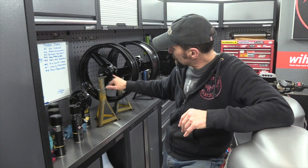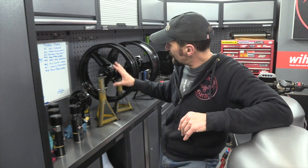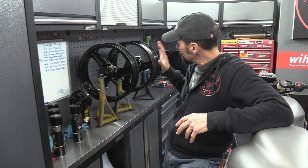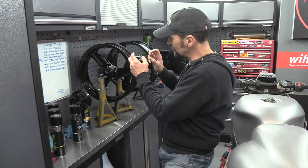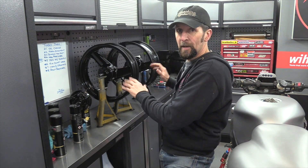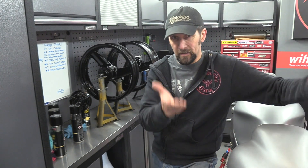I've masked everything off so all those faces are completely bare metal underneath. Once that's dried I'll blade them off so everything is completely clean and ready to be refitted. Once the wheels are back together with the sprocket carrier, I'll put the new sprocket on the carrier and put everything back together - new cush drives, new bearings, new discs, new bolts, the whole lot all renewed. The only thing that's original is the castings and I'm really happy with that. In the meantime, I'm going to take the swing arm out - that's the next job.